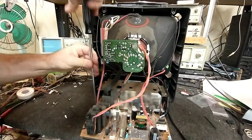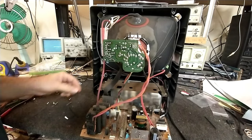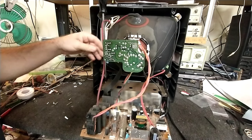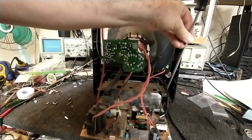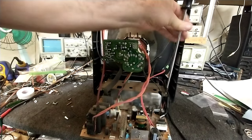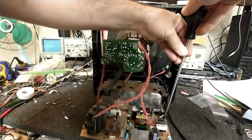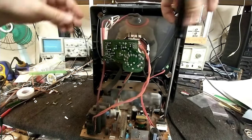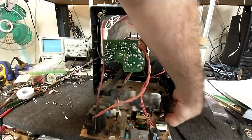We've got a screw here on this side of the board, which looks like it's a stop. This one here is still attached to the tag on the CRT. Loosen this guy and loosen this guy. We may have to undo the yoke and stuff like that to get it to slide back.